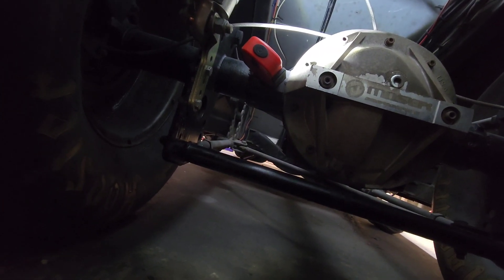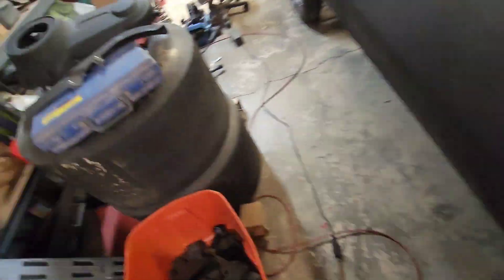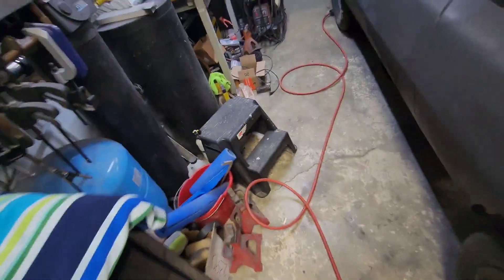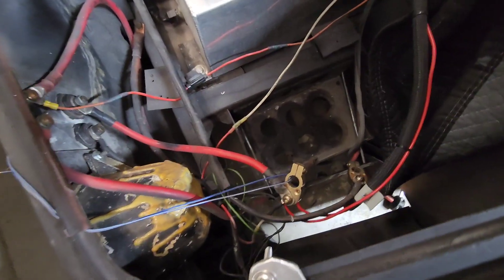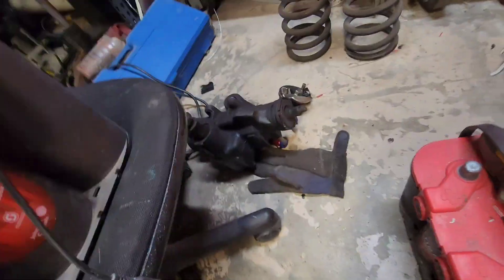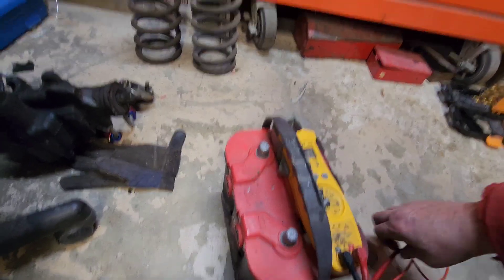It's a tight spot underneath here. Anyway, I took the battery out — I don't know what killed it. On these Optima batteries you can't hook a regular charger up to them, you have to trickle charge them. This one has been on charge since yesterday and it's reading about 9.9 volts, which was down to about 4 volts, so I don't know.